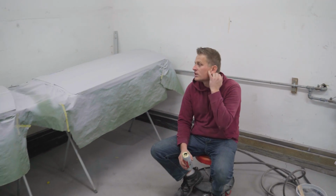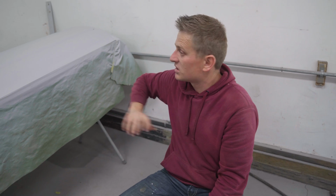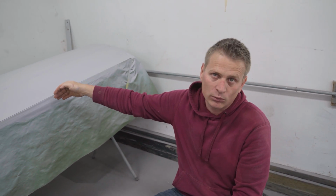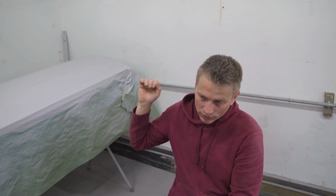See the powder, it's the same thing, but with this you don't have to worry about powder, and with the water it runs off. You apply this and then sand it down with the water and the block. First you're gonna hit it with 320. Then after you finish with 320 you're gonna do the powder, because you cannot put this kind of guide coat on wet. So that's why you're using that.